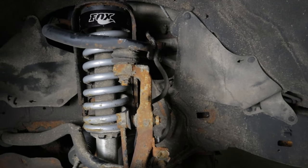I have adjustable coilovers on the MR2, and those are a traditional design — they've got lock rings, you grab your coilover wrench, jack it up, and adjust the height up and down however you want. The Fox 2.0, not so much. Fox's statement on this is that they're protecting the threads on the aluminum body. The benefit is these are aluminum so they're not going to rust and corrode like a steel shock, but those threads are going to be softer, so they've done this to prevent you from stripping the threads off — which I suppose makes sense.